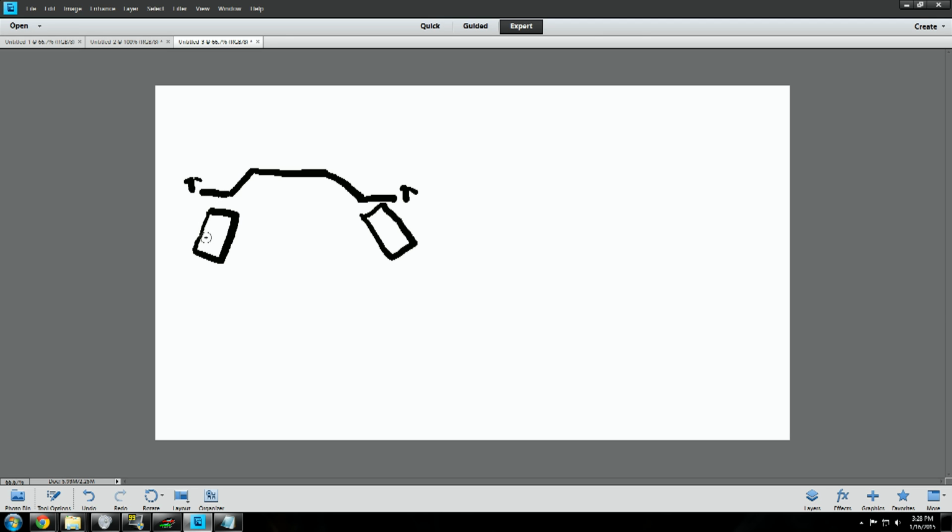Now, like I said, the way that you get your tires to do that, you've got to remember that this axle right here has a node on the end of it, and there's a node right here. You leave this node stationary, and you essentially just pick up this node on the outside. Instead of going straight out with it, you pick it up a little bit, and that gives you your camber in essentially at that point.